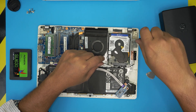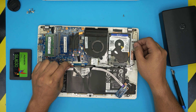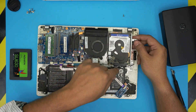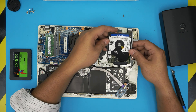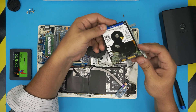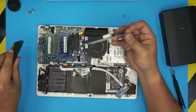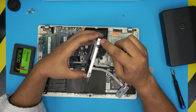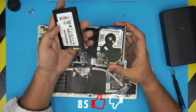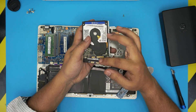All you need to do is remove that one screw for the caddy. You do not need to remove the battery — it's not necessary — but if you want to be safe, grab the battery jack and pull it back. Once the screw is out, pick up the caddy. Be careful — there's a ribbon cable right there, so don't yank on it. Lift it up a little, then put your finger on the adapter and separate it from the hard drive. Any SSDs are slim profile, so we now need to remove this caddy. It's held by two screws, and the orientation of the hard drive in the caddy must be the same as the original — if you put the new drive in the wrong way it won't match the connectors.